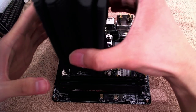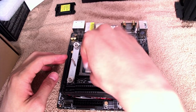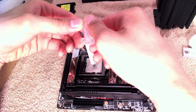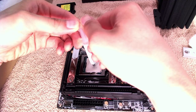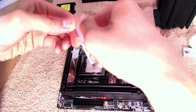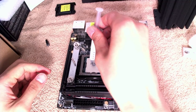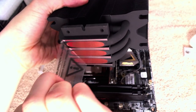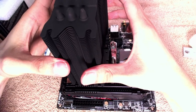We can now do a quick check to make sure that the bottommost fins of the heatsink actually clear the top of the RAM. Go ahead and clean the top of the CPU using a lint-free cloth. A good thermal paste will ensure good conductivity contact between the bottom of the heatsink and the CPU — I'm using the Arctic MX-4 here, which is pretty highly regarded. When putting on thermal paste, the best method is to put a pea-sized amount at the center of the CPU because when it heats up, the paste will flow around and cover the whole CPU. If you put more than that, it might overflow onto the edges and damage your CPU. Now remove the plastic covering on the bottom of the heatsink pipes and place the heatsink firmly on the CPU, making sure it is in the correct orientation so that it does not block the PCI slot.